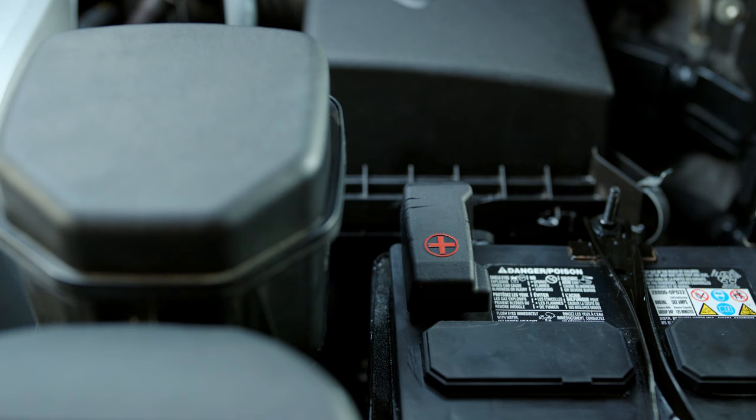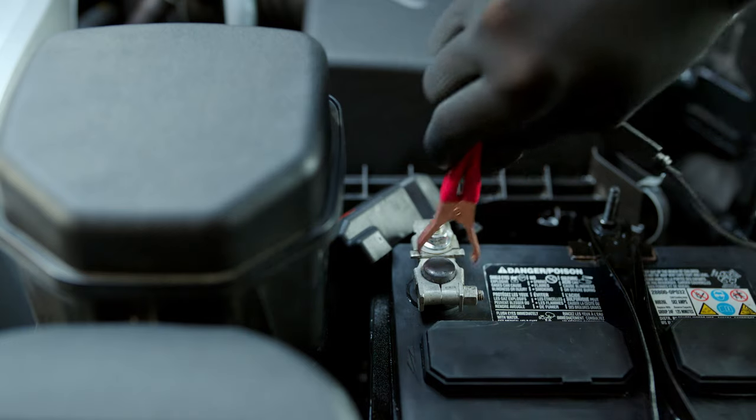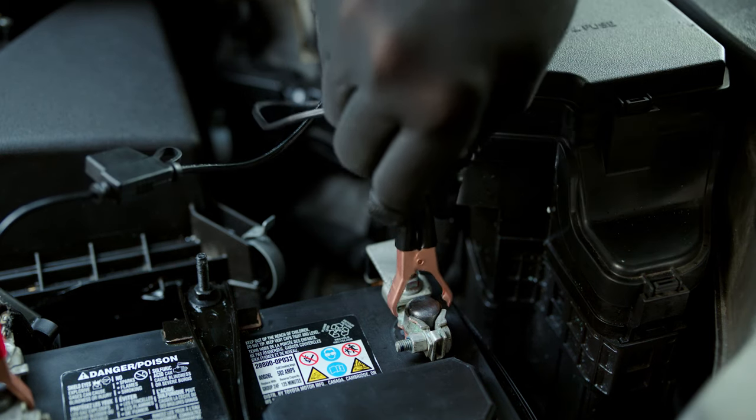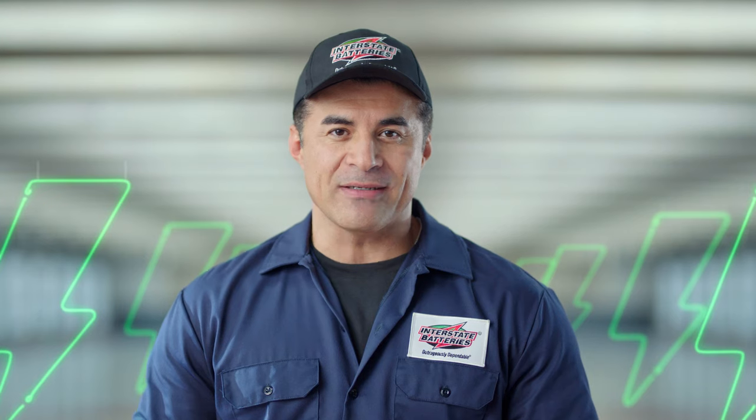What you really need is a voltmeter to test the battery voltage — it's really easy to use. Once you determine your battery needs a charge, grab your charger, take the red positive cable and attach it to the positive terminal. Next, place the black cable on the negative terminal. Make sure each cable is solidly attached before turning on your charger. Now plug in your charger and set it to the on position. Most battery chargers have an amp meter that will read higher on a dead battery and lower to zero on a fully charged one.